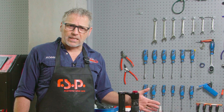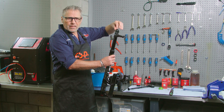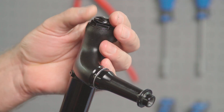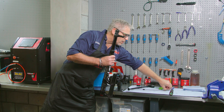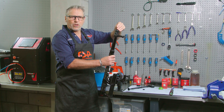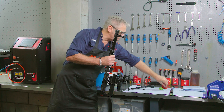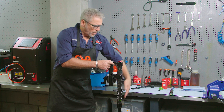To start with, we need to do the most important aspect of today's how-to, which is actually releasing the air pressure, because we're also going to reset the bearings. So we're going to open the top, take the little air cap valve off, and I'm just going to use the 2mm Allen key to release the air pressure, making sure there's no residual air left inside. Then I'm going to turn the fork the correct way around.